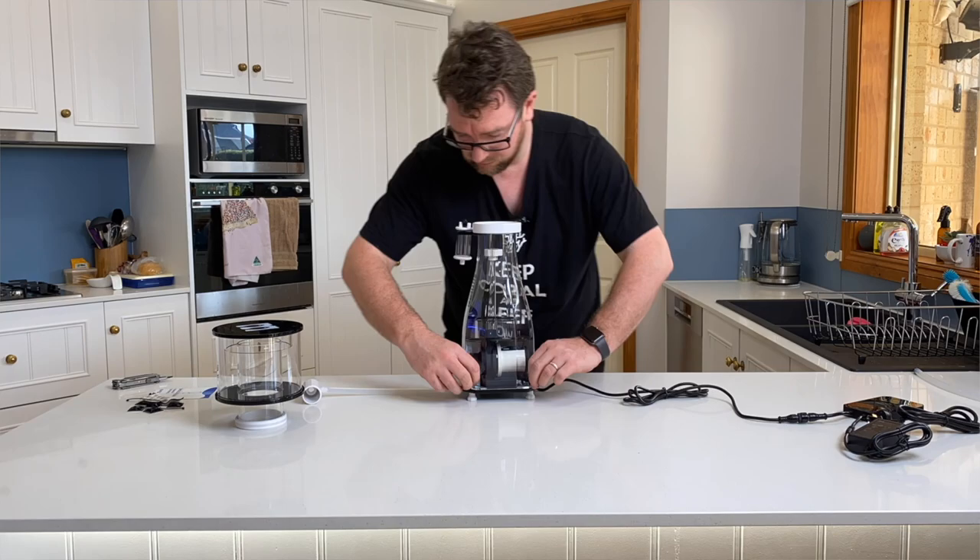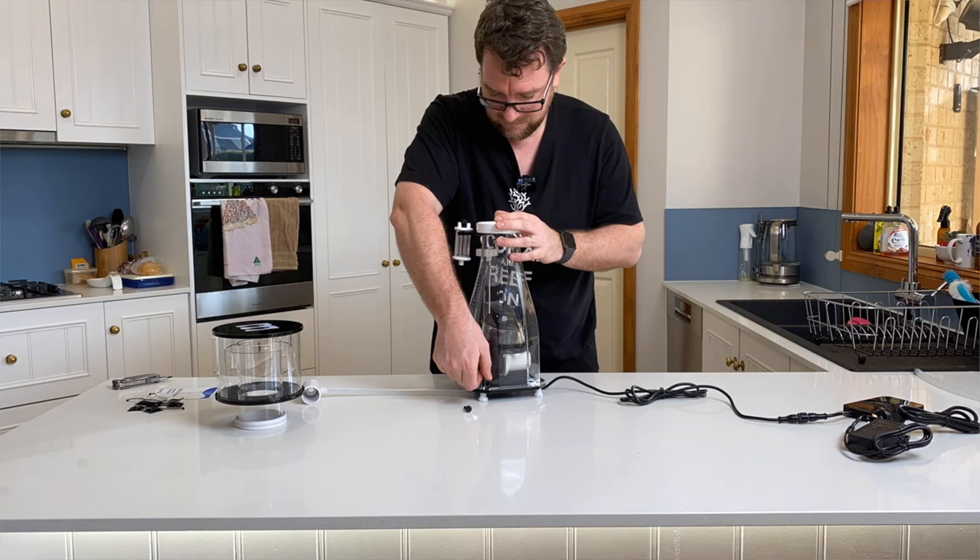The first con is probably just a lack of awareness of the unit when assembling it after disassembly — it took me three goes. When I put the volute onto the motor housing, the front of the motor housing twists onto the motor body, and when I was twisting the volute, it would untwist the motor housing, requiring me to disassemble and try again. Once I realized you just push the volute straight in without twisting, it was no longer an issue. The next con: the motor did put out the tiniest little hum. That does surprise me considering how soft those sound-absorbing feet were. You have to have your ear right next to it to hear it — not something you'll notice with cabinet doors closed. It is absolutely very quiet though.